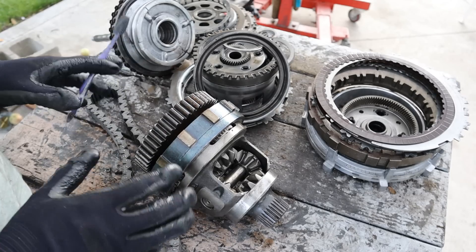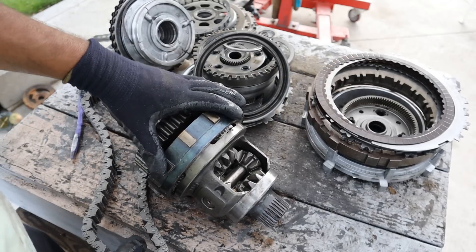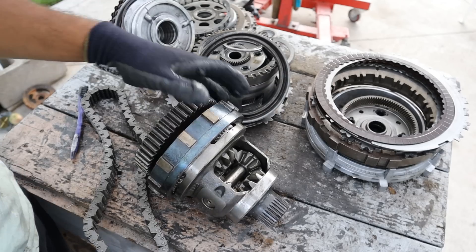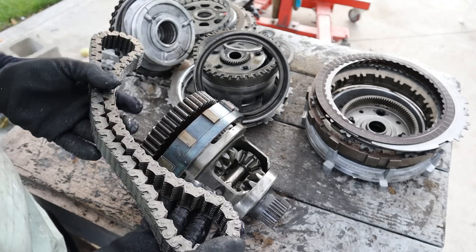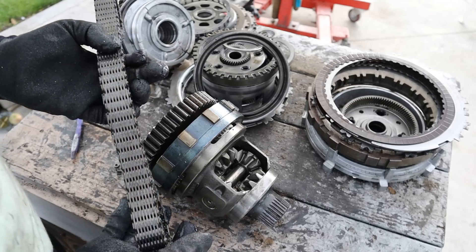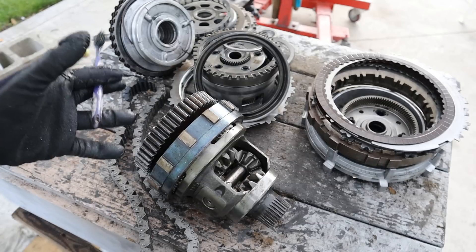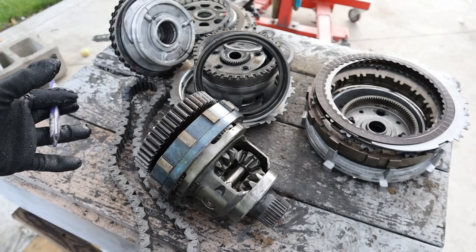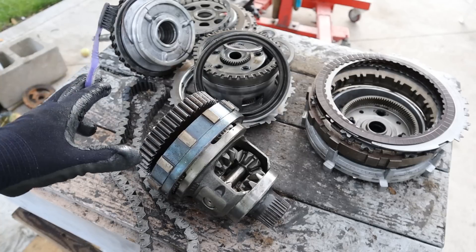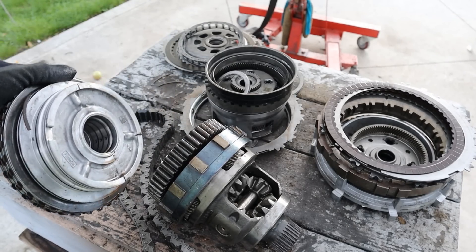And that's pretty much a look at the 6F35, 6-speed automatic transmission from Ford. I was expecting a more complicated all-wheel drive setup so we could compare it to the Quattro or the Subaru video that I did. It's pretty interesting to see that they still use a chain drive, although it's quite rudimentary and mostly limited to transfer cases because there are a lot of failure modes that could happen with a moving chain. Now reliability on 6-speed Fords is very hit and miss — the GMs actually did it a lot better. So if you do have a car with this transmission inside, may the Ford be with you. Make sure you subscribe if you want to see more videos just like this one.